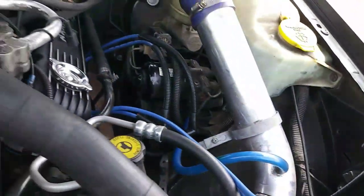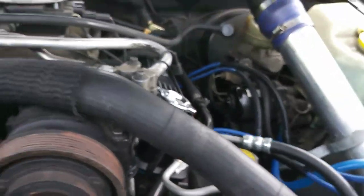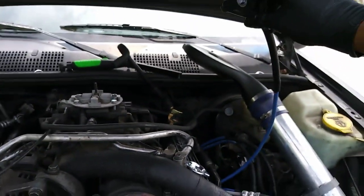And now we can match the numbers we put on the wires with the relative number we marked on the distributor cap, starting with cylinder 1 going clockwise.